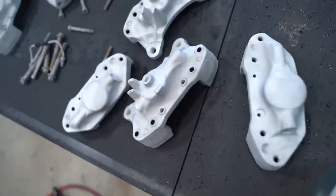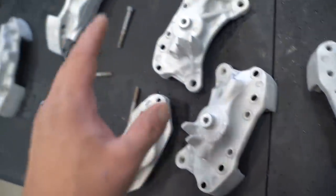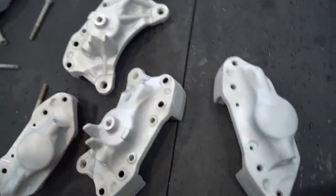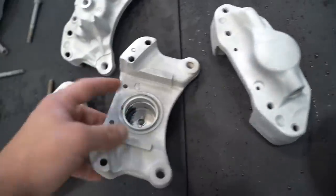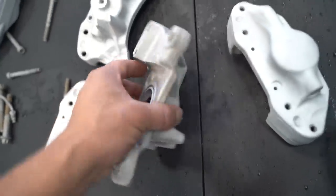Here's how the calipers look straight out of the stripper tank — they're pretty clean. I'm gonna go ahead and sandblast them just to get them 100% spotless and get a nice rough surface for the powder to adhere better. Plus there's a little bit of powder left on this brake line here. We're gonna mask them off — starting with the rears, doing both at the same time. All we have to mask off is where the piston goes and all of the threads, then we should be good.